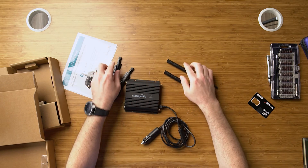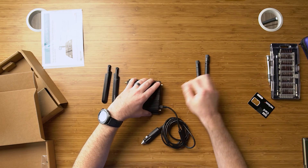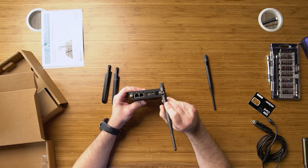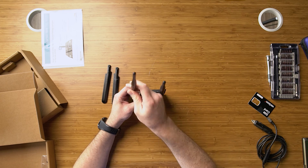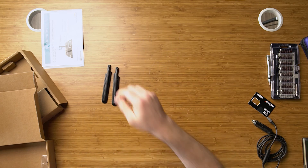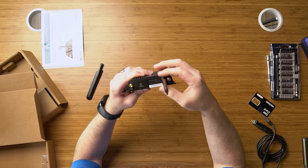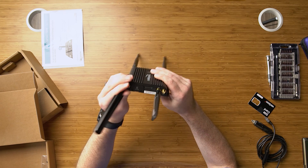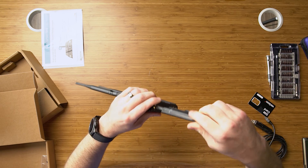Here you see we have two Wi-Fi and two LTE antennas. The 2.4 GHz antenna goes on the 2.4 connection. We have two of these so we can have MIMO connectivity — multiple input, multiple output. Then we have our cellular antennas: we put one on the auxiliary and one on the main. Once these are connected, you'll have MIMO connectivity for LTE, meaning you can send and receive at the same time.